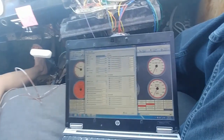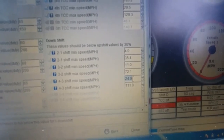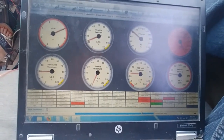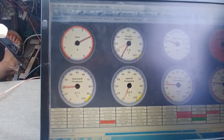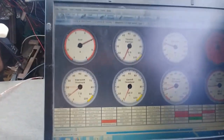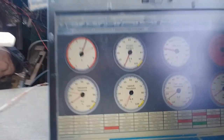What we're going to do is make the downshift out of 4th happen a little sooner, so we can come over here to 4-3 minimum. We're going to bump that up to about 30 and see what happens. What we want to see is this downshift for third gear - as we slow down the downshift threshold should fall. Once it falls below zero we should get a downshift. That was a little sooner.